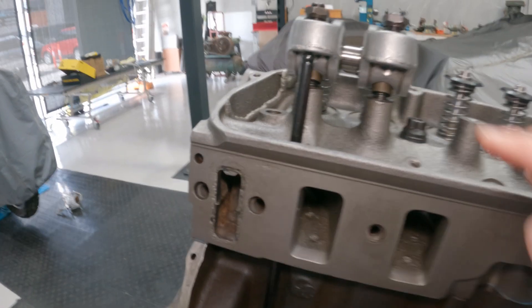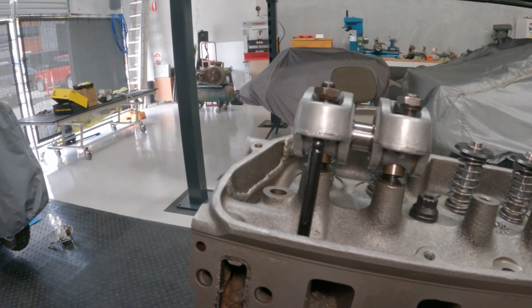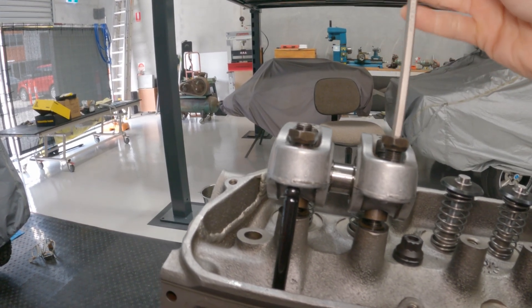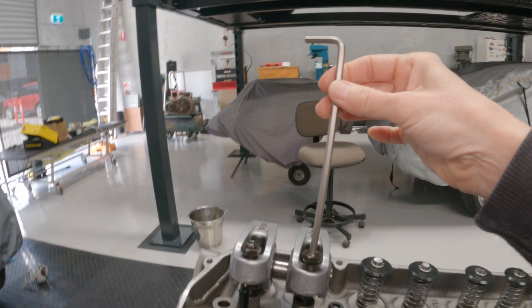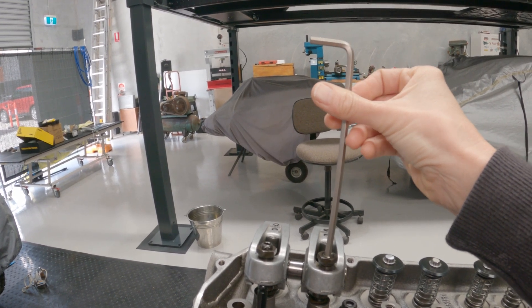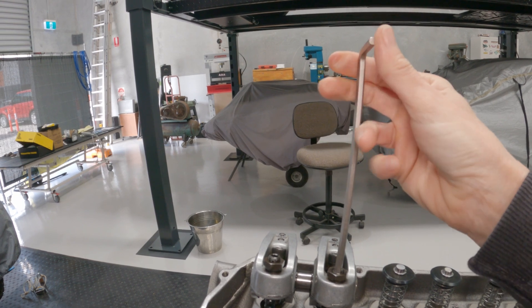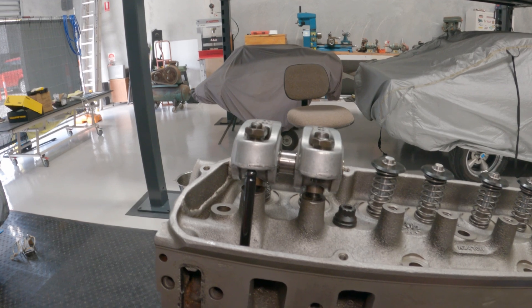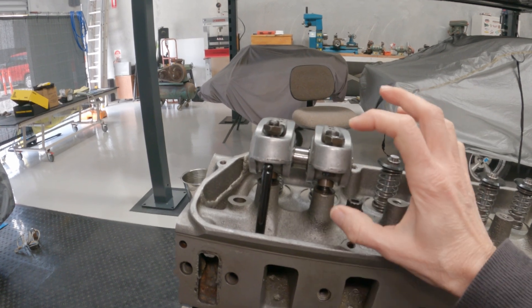So here's how it all comes together. The shims are in, and the rocker adjusters have about six turns of full travel across the adjuster range. I was aiming to have about two and a half to three turns totally taken up on the adjuster to remove all the lash and then add that half turn of preload, leaving me plenty of range in either direction.